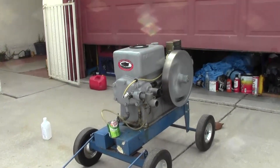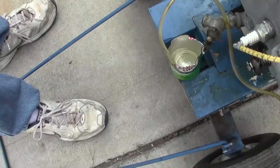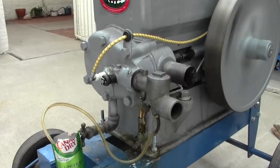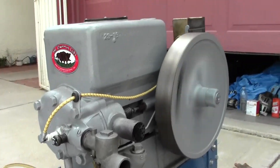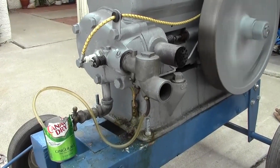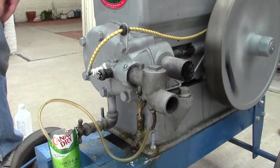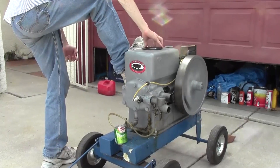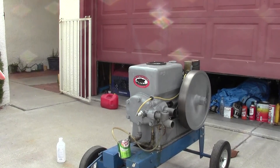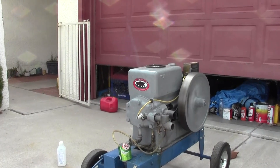It's running a little bit richer than gasoline — about an eighth of a turn more. As you can see there's almost no yellow left, so this is virtually pure rubbing alcohol. As you can see when I put my foot on the flywheel it stops almost right away, so indeed it doesn't have nearly as much power on rubbing alcohol as it would on gasoline.